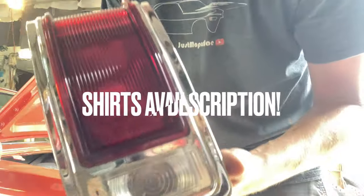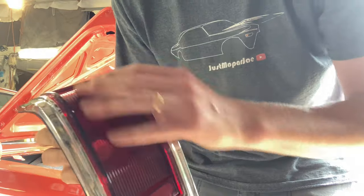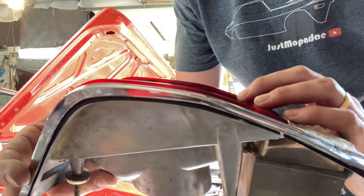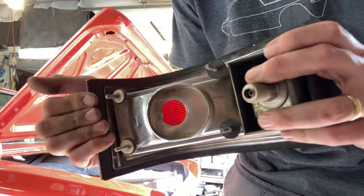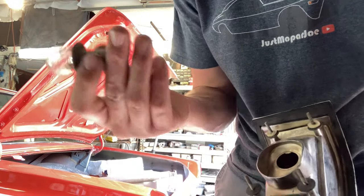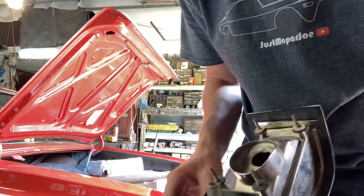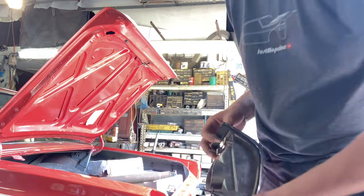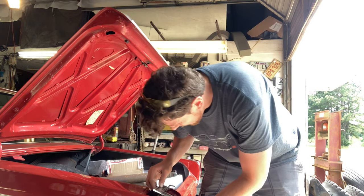But yeah, let's get some work done today. New lens put in the light — looks nice. The bottom one's still a little ugly but I don't have any more of those. He brought these — they're kind of a Chinese production lens, and it seemed to be hitting inside here. It was almost hitting in here before it laid down all the way, so what I ended up doing was double-stacking his gaskets. I had to use longer screws in the back to hold the lens, but you got to take off the backup light part. He needs a new wire for that deal but I'll stick it back in for him. His seal looks nice — I'm assuming that's the factory one. This is the left-hand side — you'll see the 'L' — but I should be able to go ahead and slide her in. It's still got a nice foam gasket in here and that black rubber looks good.